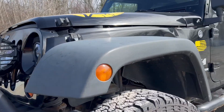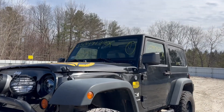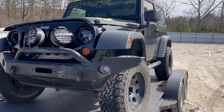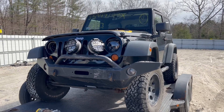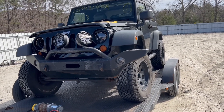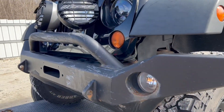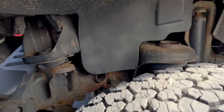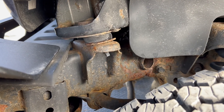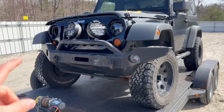The tires look good. From the damage, this fender itself bent in pretty bad. Windshield's not cracked though, so that's good. But here, when you're standing on the driver's side, you could definitely see the extent of the frame damage. Not that big of a concern. The frame damage is severe, but it's nothing that we haven't seen before. We can get that fixed. The wheels look like they're not toeing out more than they should on that side, so everything looks good. Here we see this frame rail bent really bad. I might have to get that replaced - not completely sure. I'm going to have to get the shop to give me a final word on that.